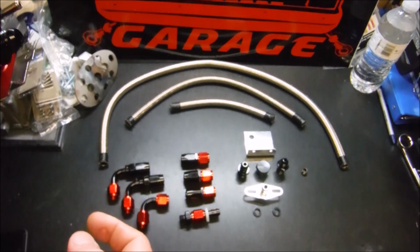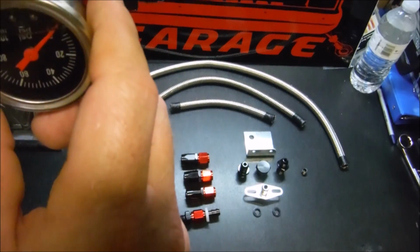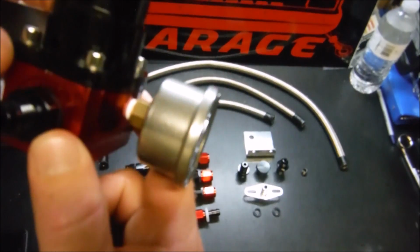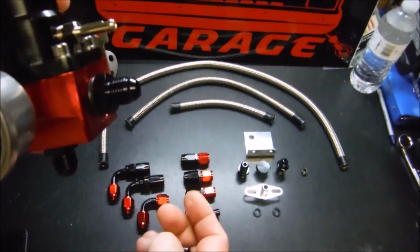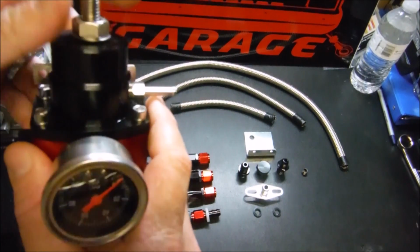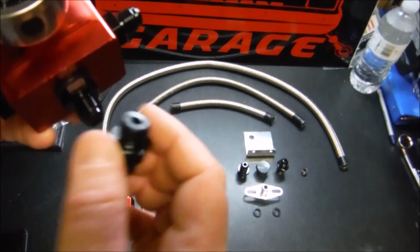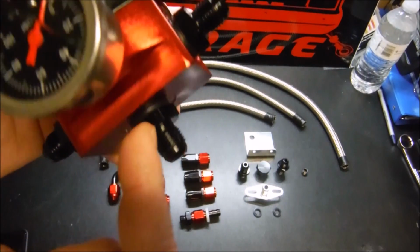And we are putting it to the test, because this is actually going on an LS swap, so it's going to be running 58 psi. So that's a lot of fuel pressure. If this thing can hold up to that, then I think we can give it a thumbs up. If not, we'll tinker with it a little bit, depending on where it leaks. If it leaks from here or here, or anywhere else, we'll send it back. But if it just leaks from the fittings here, then we'll try to get a better fitting and see if that helps. I'm also kind of wary about the rubber washers here.